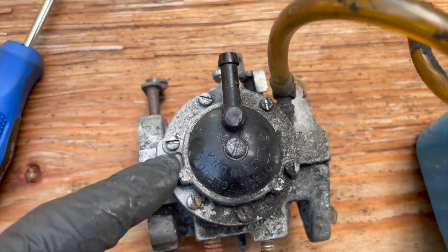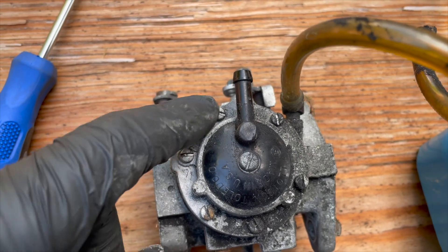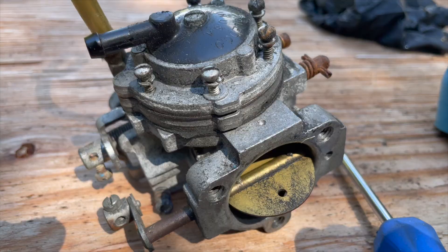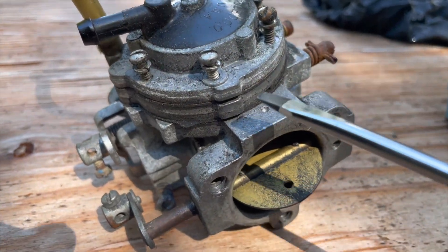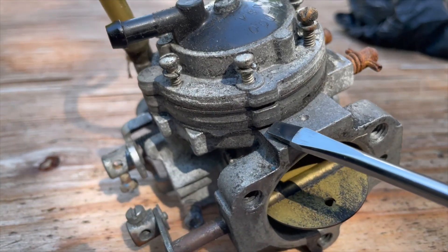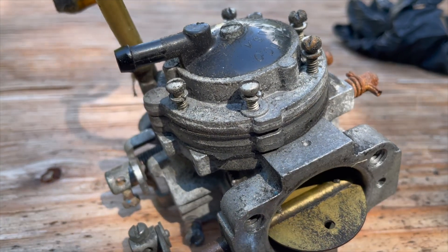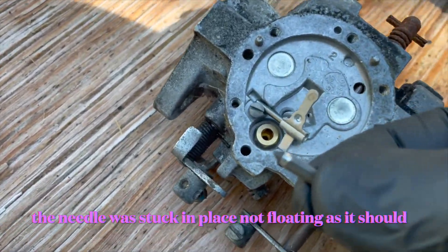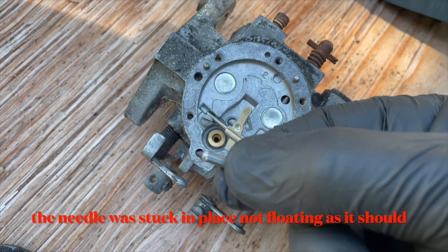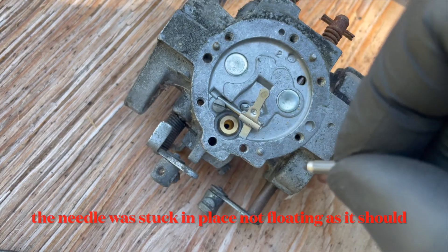Here's the fuel pump at the bottom — diaphragm fuel pump. I'm going to remove all these screws here and we'll have a look inside. Right here there's little spots where you can pry the sections apart, so we'll do that now. We got the needle out and I cleaned it up a bit, so now it should slide nice and freely in its orifice there.